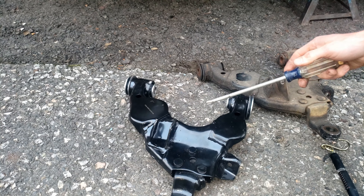It's like they throw lead inside this — look how easy that bends right back. So if you hit something off-road, and I'm really abusive on my truck, now on the Toyota one, let's throw that on there and see if we can max the scale out. We were at 50 pounds when that one flexed. We are at 50 and we're maxed all the way out, and it's flexed a little bit, but you see how it flexed right back. This metal has a much higher tensile strength and it's just better quality steel. You can flex it, but it bends right back. When the Chinese one flexes, it stays there — it doesn't really flex back.